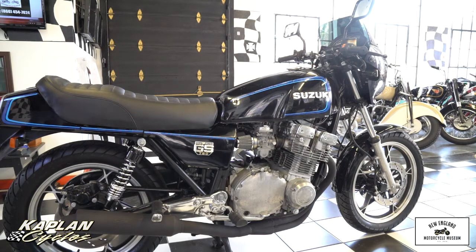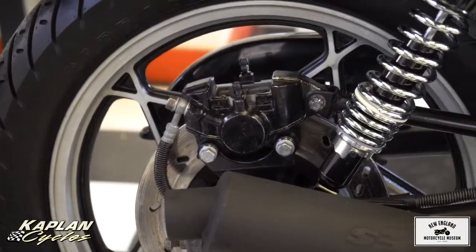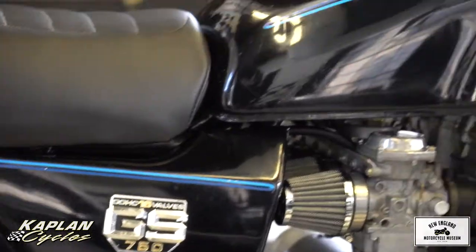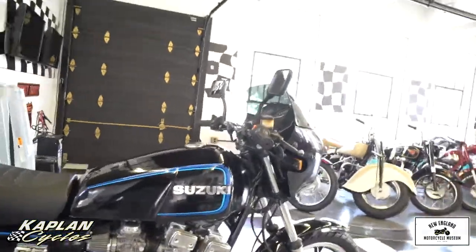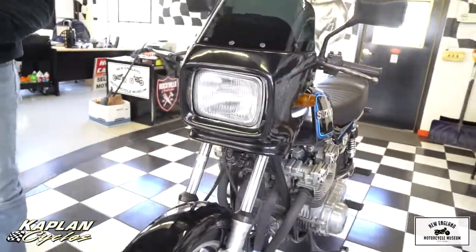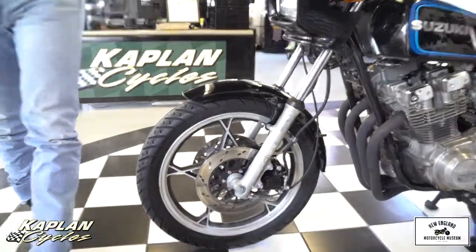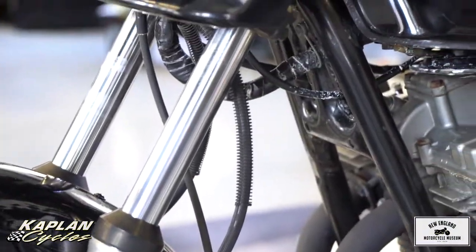The contacts inside the right switch housings were cleaned, replaced the wire terminals and covers inside the head. Inside the lamp bucket for the starter button to solenoid wire, we replaced the ground terminal at the solenoid and cleaned the ground contact to the frame. Replaced the terminal cover at the solenoid for the start button wire to trigger the solenoid. We replaced the positive cable lugs at the battery and the solenoid, replaced the wire and the terminal connector to the fuse panel, replaced the negative cable at the battery, and cleaned the frame ground contact.